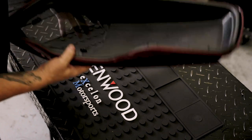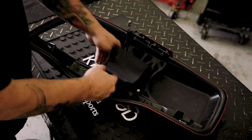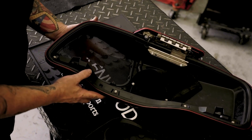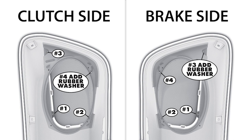Trim the cable and flare the handle. Re-fit the inner lid lining and factory latch mechanism. Fit the speaker adapter in the lid and screw it into place, fastening the speaker grill at the same time. Be sure to screw in the mounting plates in the order shown here, noting to also add the rubber washer in the correct location for each lid.